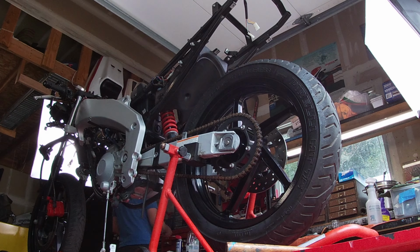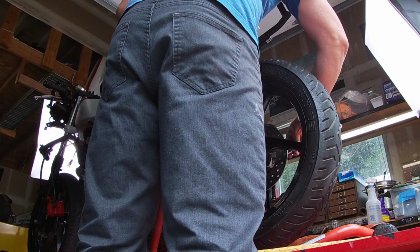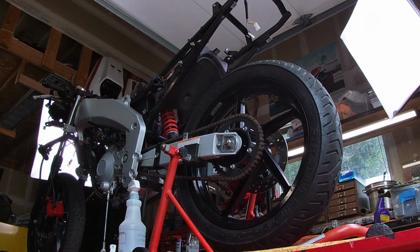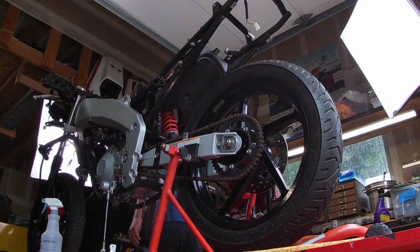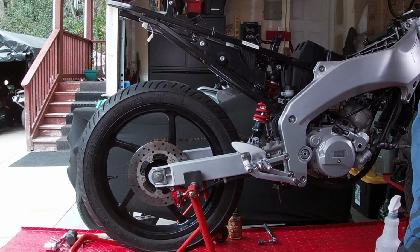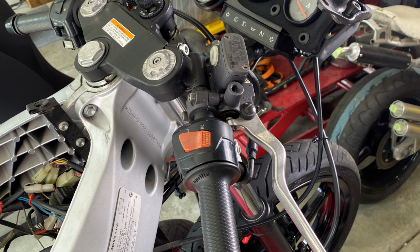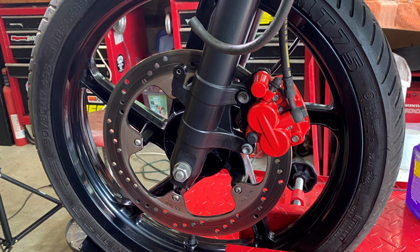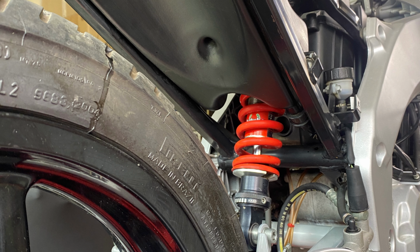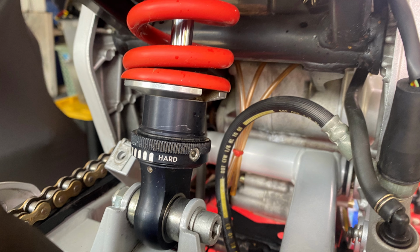At this stage, the client and I reassessed the project and decided to increase the scope of the restoration to include a fabrication of a remote choke lever, as the local one on the upgraded carb cannot be operated without feeling for it under the tank. The Cerakote, all the fairing brackets and rear foot peg mounts, which have some surface rust, and to completely revise our approach to restoring the fairings. So we'll have to cut this video short at this point, but with the bonus of more content in the next RS50 videos to come.